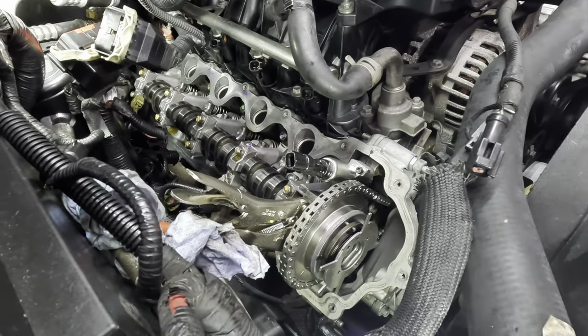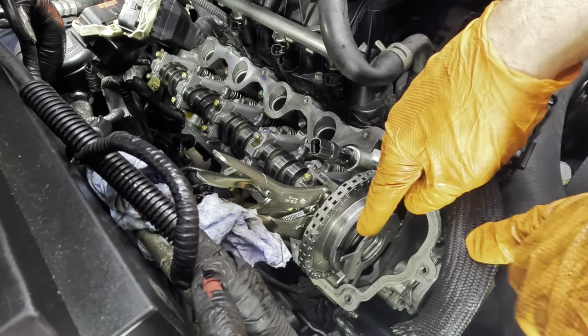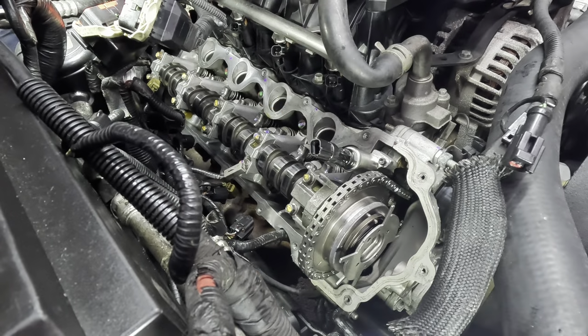So now you know that I do know how to use a torque wrench. I have several of them actually. A whole drawer full of them. Oh yeah, one other thing. Those are new bolts. Phasers came with a new bolt. The people at Ford know better. They won't sell you a phaser without a bolt.